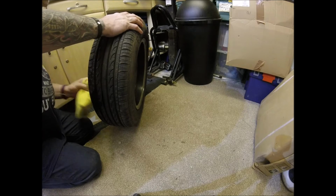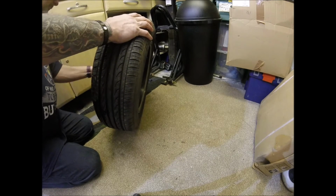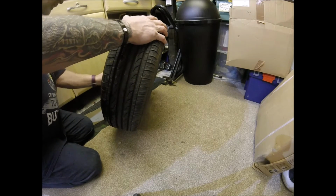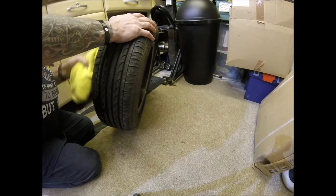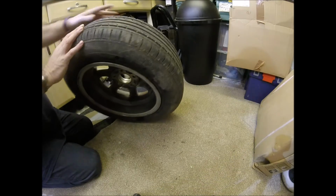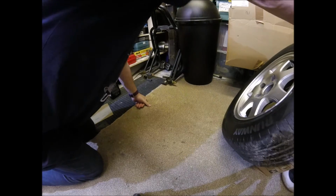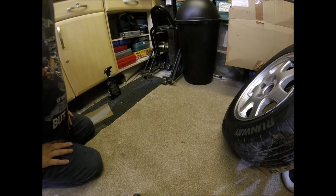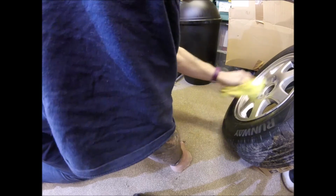Whatever you do, do not ever be tempted to use your steadying legs to jack up your caravan, or even to try and hold the weight while you change a wheel, because all that will happen is you'll either bend them or possibly even push the pad on the top, which fixes to the floor, straight through the floor, and you end up with a caravan steady in your bathroom, your bedroom, under the bed, God knows where. Right.